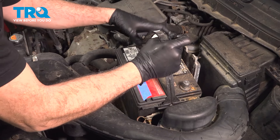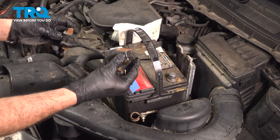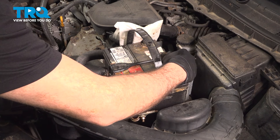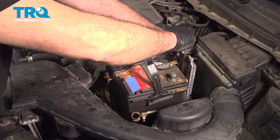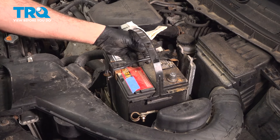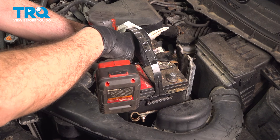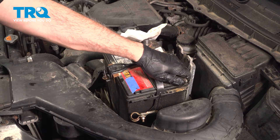Go ahead and take your battery and line that up. We're going to take our J-hooks here, drop those down, and line those up into the tray itself. Twist that rod so that the J hooks up into the mount. Don't put your fingers on this when you're tightening it — hold on the sides and snug this down evenly. Make sure those are snug but not enough to crush the battery. Go ahead and give that battery a wiggle — that's in there pretty good.